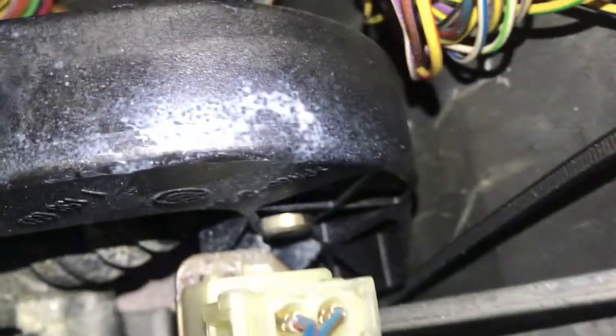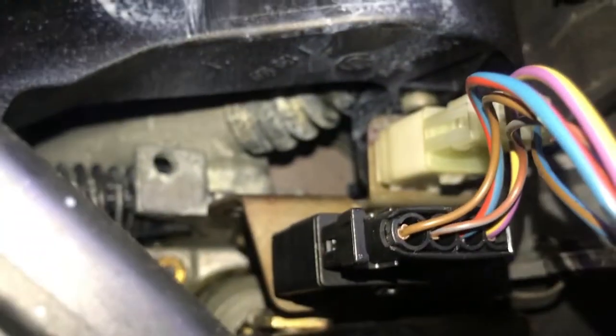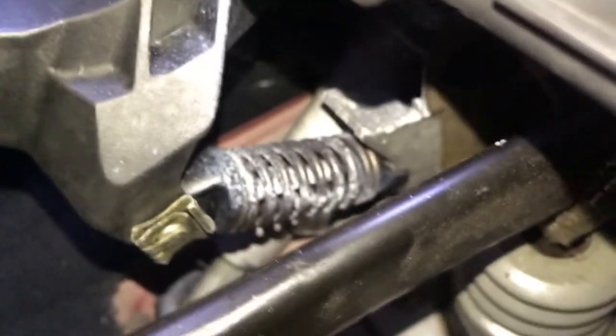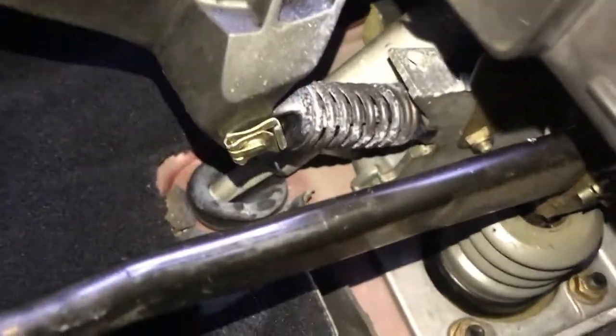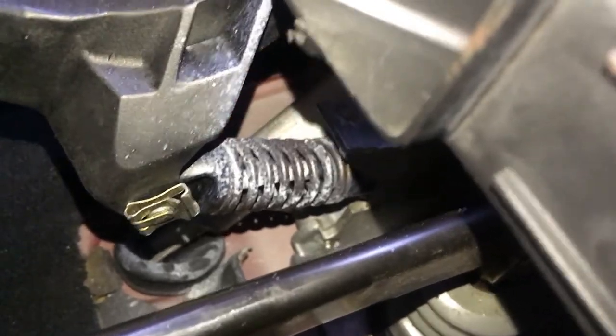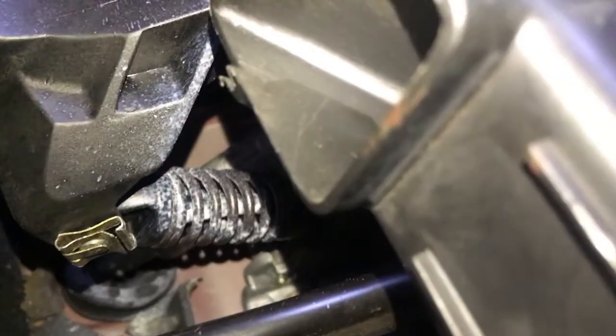Here's the clutch pedal. When I press the clutch, it goes in and starts engaging from here — right now it's disengaged, and as soon as I press it the master cylinder gets pressure and it engages. That is not a problem with the bushings — it is actually a problem with the spring and the master cylinder itself, so I'll need to replace the master cylinder eventually. For now, I'm going to delete the spring. I've seen a lot of people do it on their E92s and Z3s, so I'm going to try it and see how it feels.